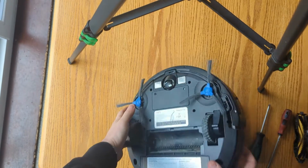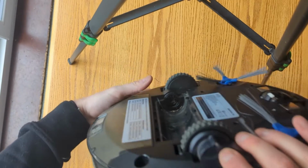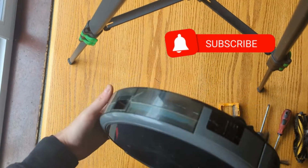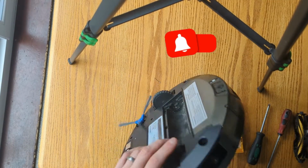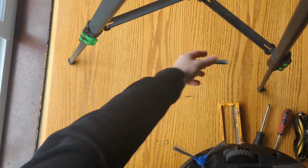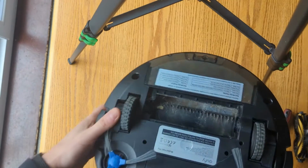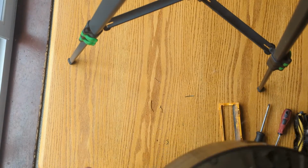The second and more complicated fault you will have is with the roller brush motor. To see if the motor is completely dead, you can turn your Hoover over and put your finger where the roller brush goes. This is probably half the reason why mine's getting jammed up, as well as the frigging Nerf bullet in there. How on earth has that happened? I probably should have cleaned the pot out before I did this, but you get the real life scenario with me. So turn it on.